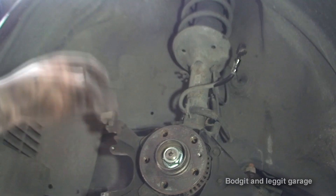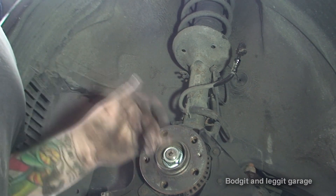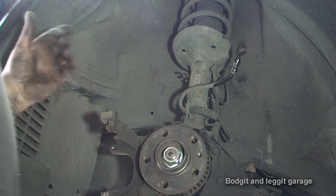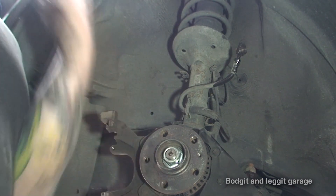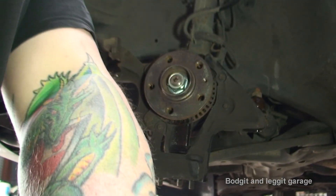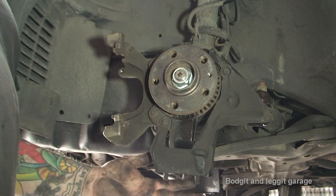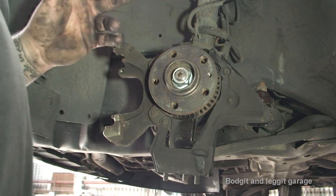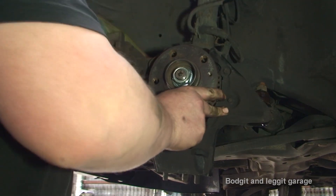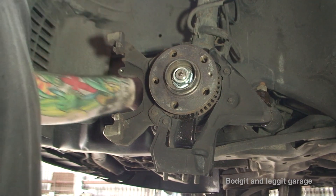Next thing we need to replace — we're replacing the full drive shaft. On the far side we just replaced the CV joint. If you want to know how we got to this point, watch the video on the brakes and the drive shafts. What we've got off: we've disconnected all the brakes and disconnected the bottom wishbone. Now hopefully this is going to come through on camera. I've loosened everything, but there's a big clunk in the drive shaft — again, it's all because the rubber boot is broken. It's been broken for a while. Once we get it off I can show you more clearly.